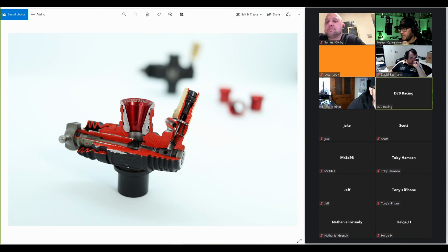At idle or partial throttle, what's limiting the fuel flow is the low-speed needle that goes inside the metering valve into the spray bar here. So that's what's limiting fuel flow. More fuel could flow through here, but it just gathers in here because it's limited here, entering the carb. When we know our idle gap, we only need to worry about the low speed needle for the engine's idle and how the engine accelerates when you get on power after idling.